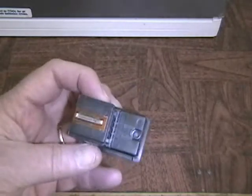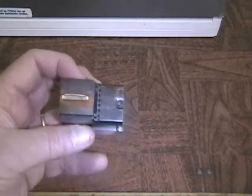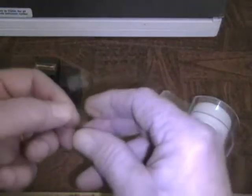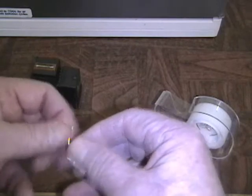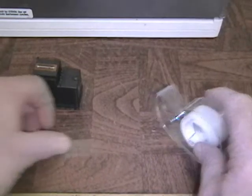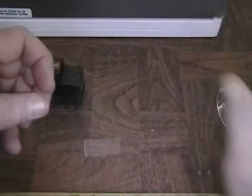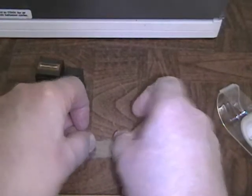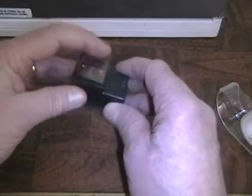So this is the print head portion of the ink cartridge. What we want to do is cover that up some way so that the ink doesn't get soaked up by something or has a little less exposure to the effects of air. We're going to take a small piece of tape and fold it back on itself a little bit — like so. Then we'll take a bigger piece of tape and stick it across there, so there's no sticky surface on the print head.